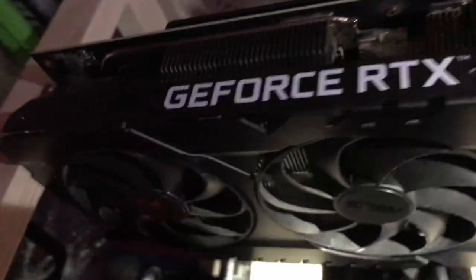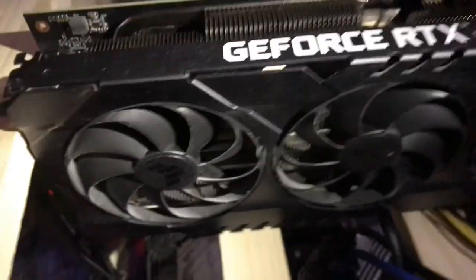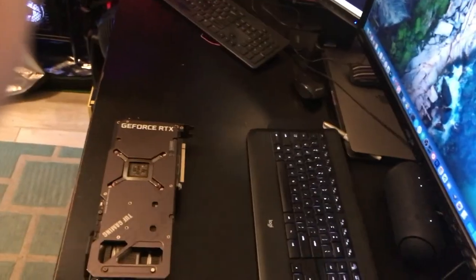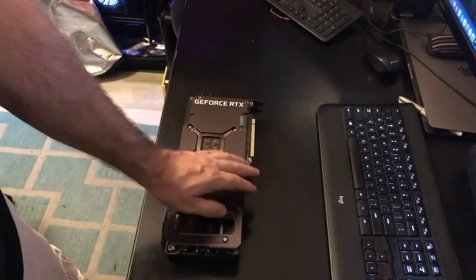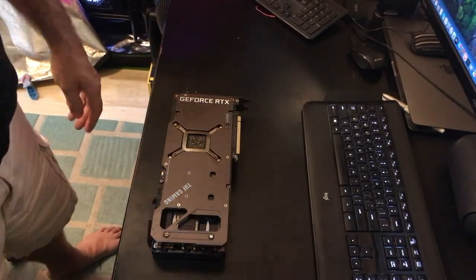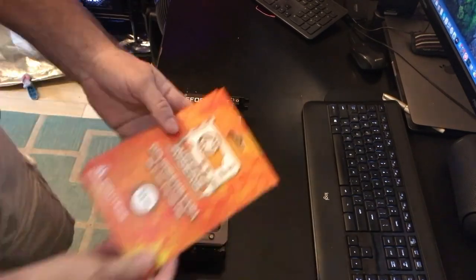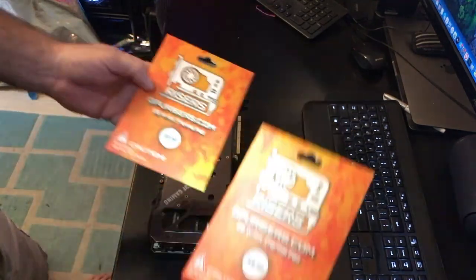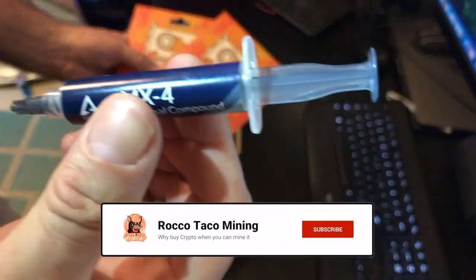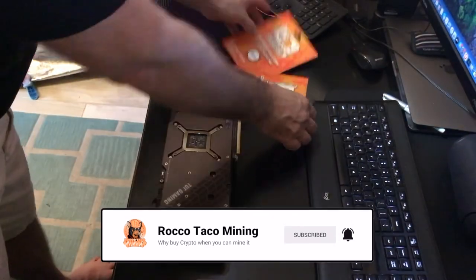I got thermal pads in from GPU Risers. Once you strip one of these down it's pretty easy to figure out how to do it again, it just takes time. I'm going to walk through this at 2x speed. You just find which screws to pop off the back. There are the GPU Riser thermal pads - 2mm and 3mm. Pro tip: use lots of thermal paste, don't make a nice thin coating - gob it on, because it'll make a huge difference.